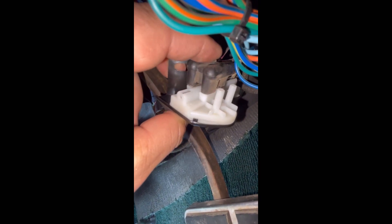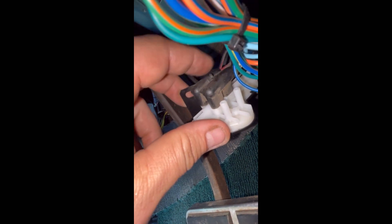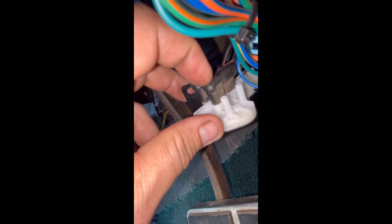It's time to get swapped out. There's the new one right there. This plug is really hard to get off — you're going to have to use a screwdriver or pry bar to lift each individual terminal. Pull those out. Your two vacuum lines — it doesn't really matter which way they go, there's no in or out or valve in there. Now I just put it up in place, get the two lines on it, put the two screws on it, and set it in the right position where the steering column goes.